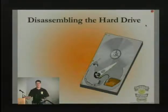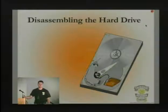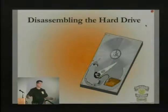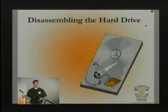And there are times where if you're up high enough in a plane that your hard drive could actually crash because there's not enough air pressure to keep the head floating over the platter, and it will hit the platter and start to scrape it. But there are some hermetically sealed ones, like the Air Force and things like that have some hermetically sealed drives, but you're not going to find those on the shelf at CompUSA or wherever you're going to go and buy one of these drives. So you can kind of take the cover off of your hard drive and look at it.